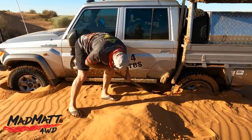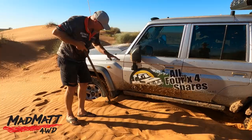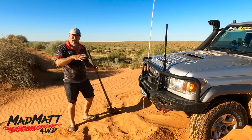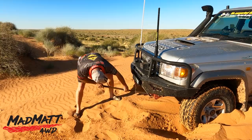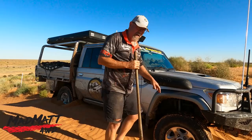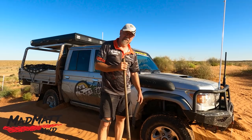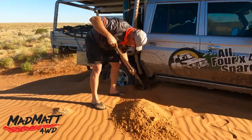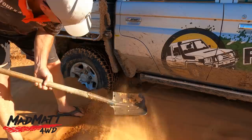You can see how the springs now clear here, so that won't hold me up too much. This sand isn't really a problem, but further in under the vehicle it probably is. But we're just going to try digging the wheels out first. Now I'm just clearing out under the front diff a little bit and the front radius arms. Sometimes when I'm watching people dig out from a bogging situation, they put energy into digging the sides of the tyres - completely pointless. You want to dig out where you're travelling to. Now there's those springs clearing out again.